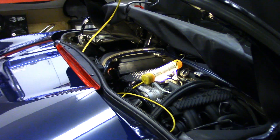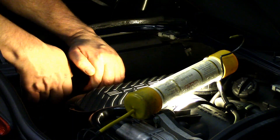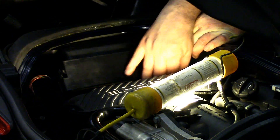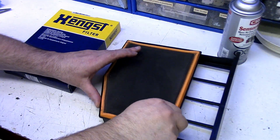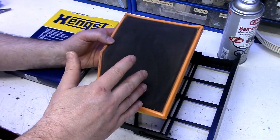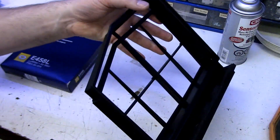The air filter is located on the left side of the engine bay — that is it right there — and there's just a cover that unclips and then the air filter slides out. These covers are usually pretty tight to get off. I find it easiest to get the inside clip or the front clip from inside the car, and this just slides out with the filter. They just lift out. If this was really dirty when you pull it out there's a good chance a lot of the debris will fall back into the air box, so if you suspect that at all get a shop vac down in that air box and vacuum it all out. If it was really dirty you might also want to clean it out with soap and water.